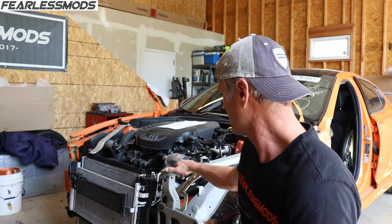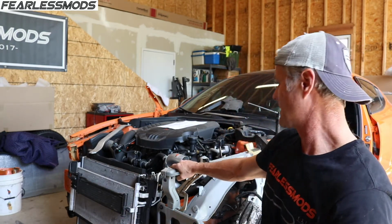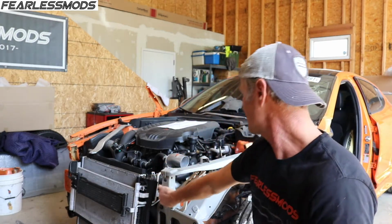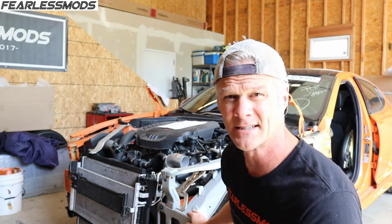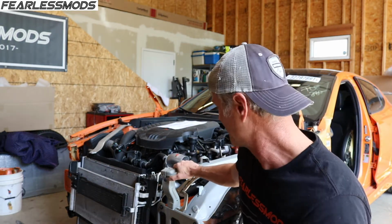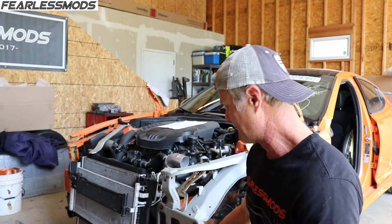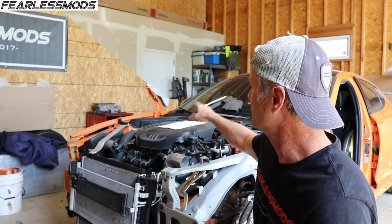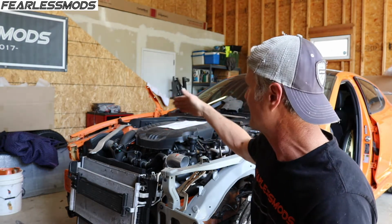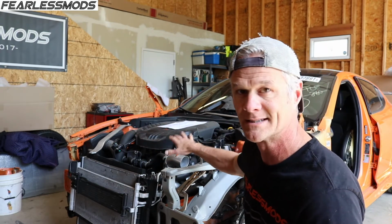All right guys, catching you up here. We've got this piece in and it's looking good. Couple things tweaked on it that I'm going to want to tweak back. And I think that's just a result of shipping. First thing I'm going to do now that we've got our tool built for taking the measurements is I'm going to go ahead and take off the door and fender on the other side so that we can get to some of those points that we need to measure across, and then we're going to go through and measure all of these and see where we stack out.